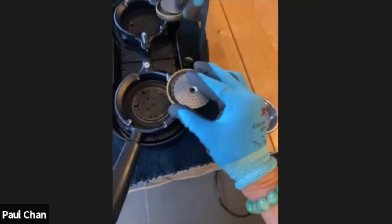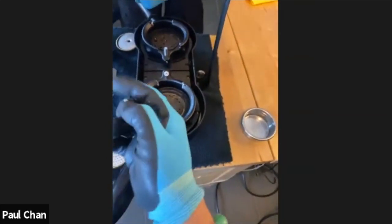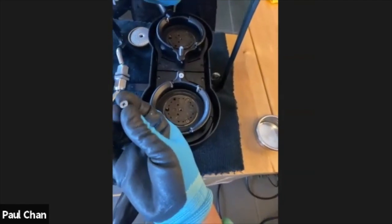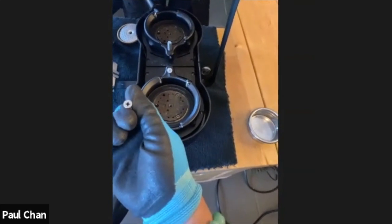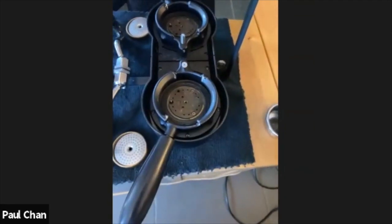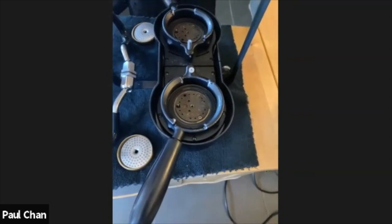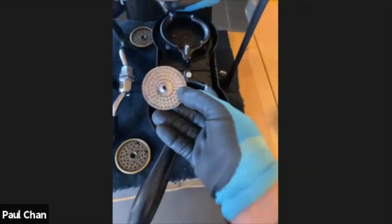So the main screw that we've just taken off is just a Phillips number 2 screwdriver, and it is important to use the right size Phillips screwdriver. What you don't want is to start losing the teeth on the screw. If it is not snug fitting, you can try to use it, but I would suggest finding one that is snug so you don't have to replace that screw.